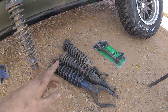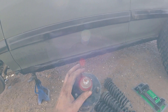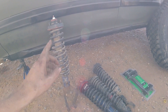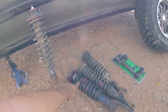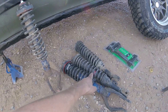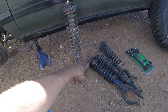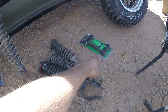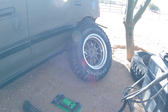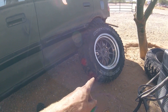So this is how to raise your civic wagon. You're gonna need some spring clamps because these are three-post struts and civics have two. We're gonna have to take those top hats off and swap them out with the stock ones. These are off a 90 to 93 Accord, and these are DA rear Acura Integra struts. These cost me a hundred bucks for the set - fifty each from different junkyards - and the spring clamps were like thirty bucks, but most stores let you rent them.